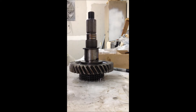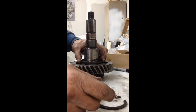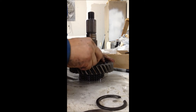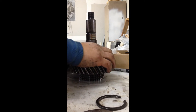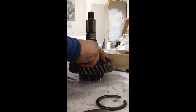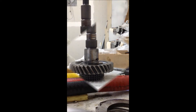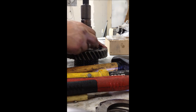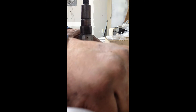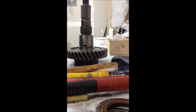We're going to continue with the main output shaft, just as we did with the other one. You remove the big snap ring and your shims and thrust washers. There's a little detent on there holding it out. After you get your thrust washer off, you may do like me and fight it for about ten minutes before you realize that little detent pin has to come out — just pop the little pin out. Then the washer will come out and expose the needle bearings, and you can change them out and put it all back together.